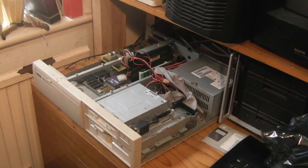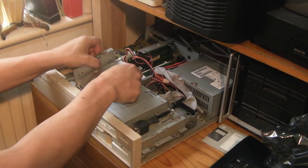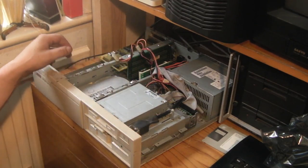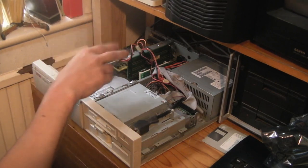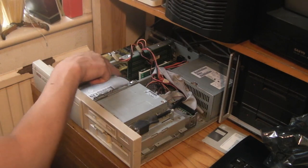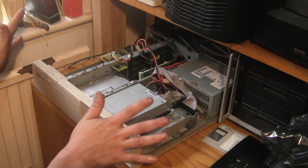Okay, we're back over to the DEC 486, and first thing we'll do, we're going to just stick the hard drive basically back in, not connected up, so that I don't lose it anywhere. It's not going to get damaged. It's not causing any issues in there. It can just sit there. And if for any reason I want to revert back to a spinning hard drive, it's just a case of pulling the disk on module out, reconnecting the IDE cable. In fact, where's that? I'll find that small IDE cable that was connected up before, and I'll just leave it connected up to the... I think I've left it on this table over here. I can put that back in when I finish this thing off. So yeah, we've got it back to how it was.